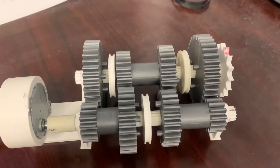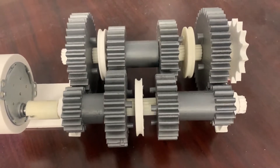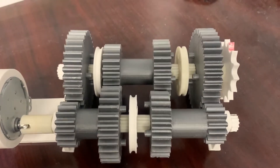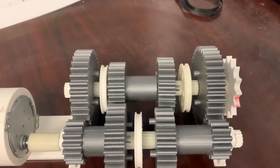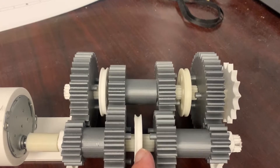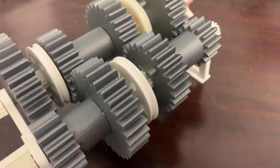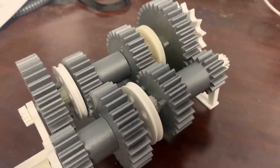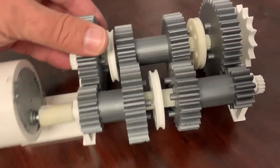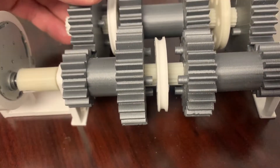The Gas Gas Pro transmission is fascinating because you're able to get six individual gear ratios out of four pairs of mesh gears. The way it works is all power is transmitted through these shafts. The shaft has a slider that is splined onto it, and then the slider has holes that can engage dogs on the gears. Right now it's in neutral — you can see that this slider is still turning because it's engaged to the splines that are turning, but nothing's engaged.